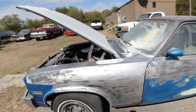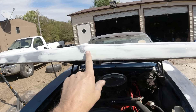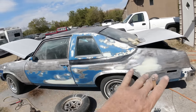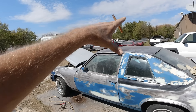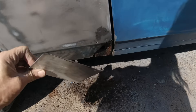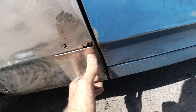I got that edge of the fender stripped. A little bit more bondo to put here and there. Filled in with bondo glass and then some bondo over top. The rest of it's pretty much ready to prime. Been spreading bondo, sanding, blocking. Except for that half of the roof over there which needs a little more sanding. Here's the little patch I made — I'll put it in there like that. I'll probably blow through the metal on that edge but I'll keep tacking it on there.